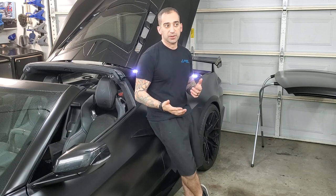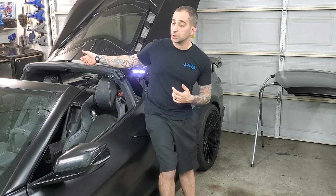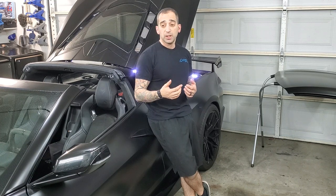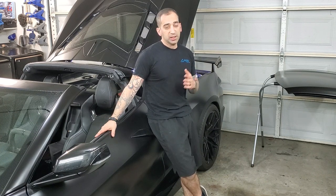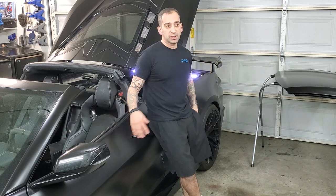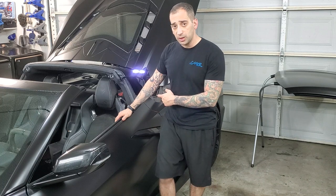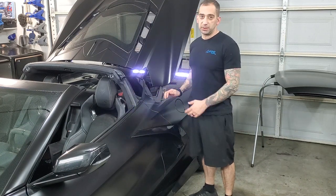When narrowing it down, the first thing you have to ask is: is the car a Z51 or not? On Z51 cars there's an auxiliary cooler on the passenger side intake, and that cooler is going to get in the way a bit — it's not something easily removable. So for that reason, do it on the driver's side. This is a Z51 car so I'm going to show you how to do things on the driver's side; on the passenger side it's basically just mirrored. There is a fuse box in the center and there is a pass-through through the firewall — which for this video I'm referring to as the wall between the passenger compartment and the engine compartment.